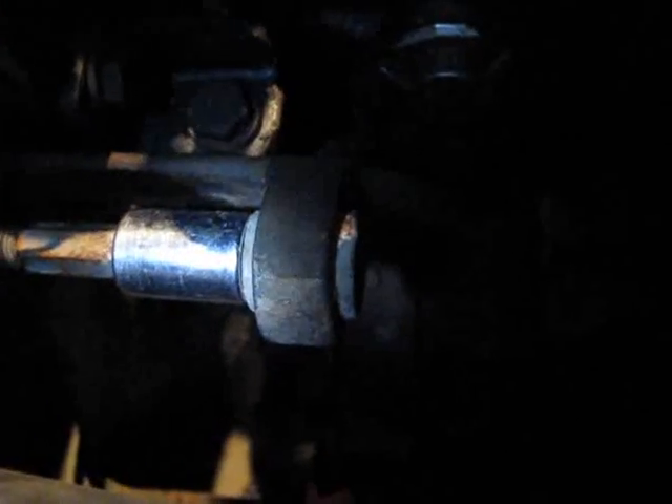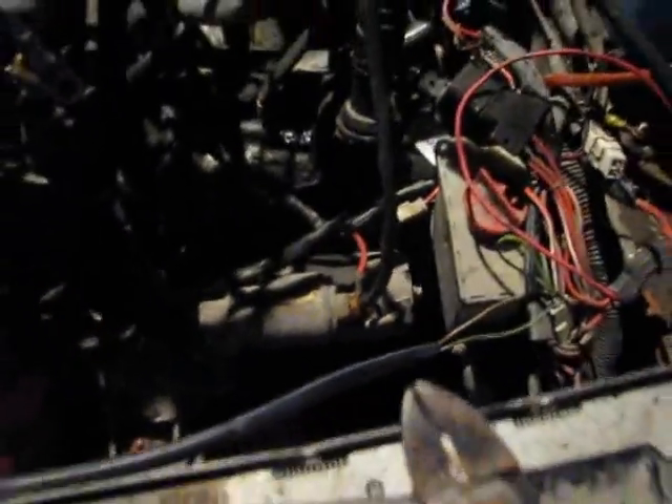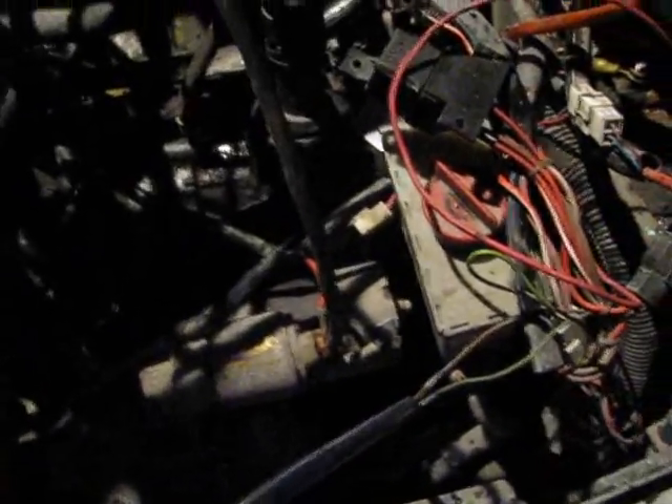Here's a cool little trick: if you're having trouble getting the alternator in because of that little friggin' spacer thing, what you do is thread the bolt into this side, put something in between the bolt and the spacer, then tighten the bolt and it'll wind the spacer out. See — it's moving it out, so now I can get the alternator in. Other than that I'm almost done — got all the wiring hooked up. Need to put the battery in. I had to make a new starter cable — I'll be replacing that with a heavier gauge one soon.